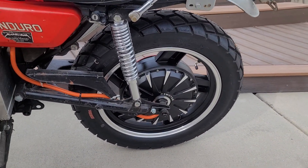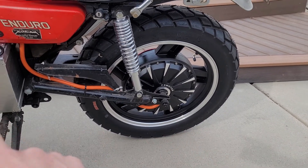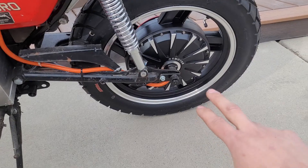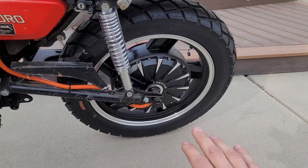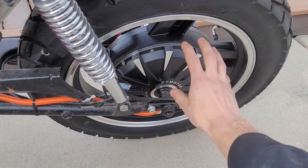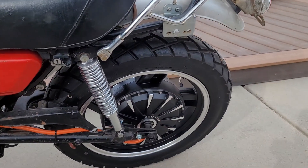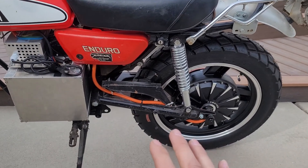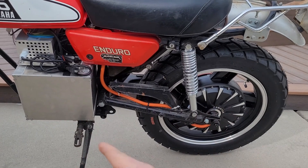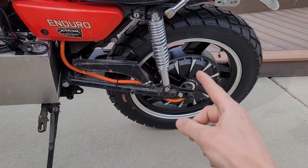In the rear, I took out the stock rear hub because it had a chain drive on it, and this is not chain driven. This right here is the motor — it's a 72 volt 3 kilowatt motor. This is the power that feeds directly into the motor. The axle stays stationary and the whole wheel spins around it. When you make an electric motorcycle, you can either use a motor with a chain drive to get more torque, or go with a hub like this where it's direct drive in the rear.